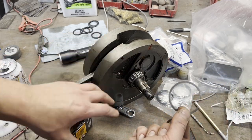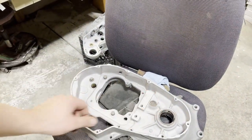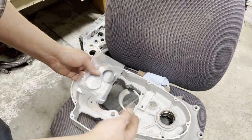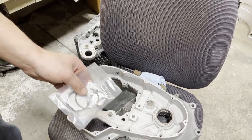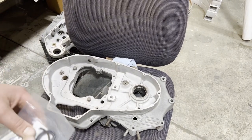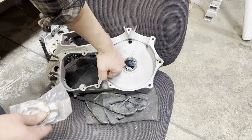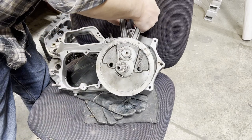We also have the last snap ring needed for the outside of the case half over here — I don't want to throw that one in yet. We also have the seals. Before I go any further I do want to finish the cleanup on the case, make sure I'm not getting any metal shavings in here before I do final assembly lube on the bearings. Then I'll press these back in. Essentially the crank bearing will come in from this side, drop in here, and get pushed all the way seated. The other bearing will come in from the other side.